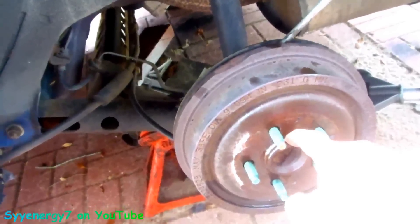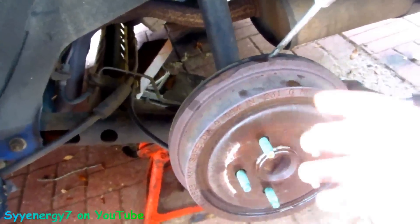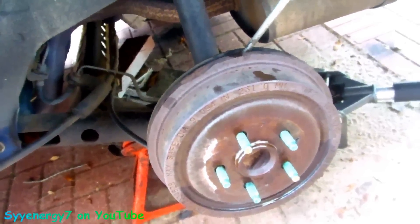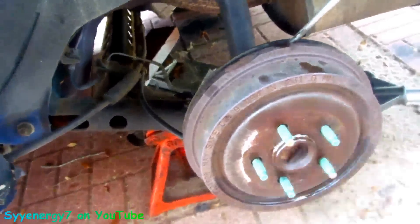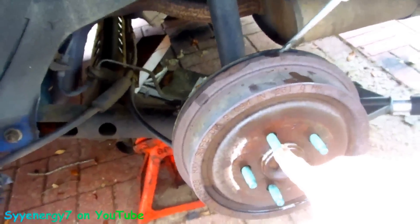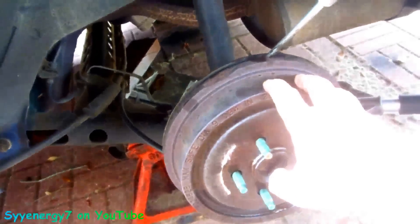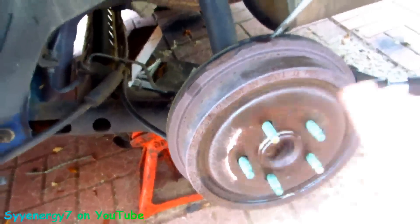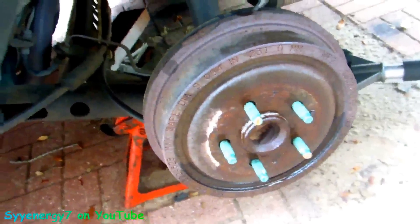You're actually microscopically doing stuff a little bit at a time. What happened in my case: I had this all cleaned up, all the rust cleaned off the outside, and I was getting it pried away from here except this little spot down here. At the end I had three screwdrivers around here and I was just working it, working it for a long time - tapping it with the three screwdrivers, and they would pop out and all that. Finally the whole thing just popped all at once. After that I cleaned up the hub real good with a wire brush, chemically cleaned it, put some rust-killing primer on it, cleaned everything up inside and outside, and then put marine-grade grease all around in here after the paint was thoroughly dried. Now it'll slide on and off easy.